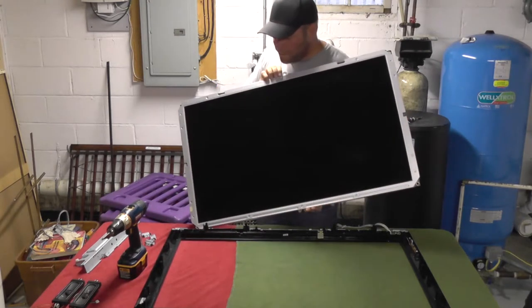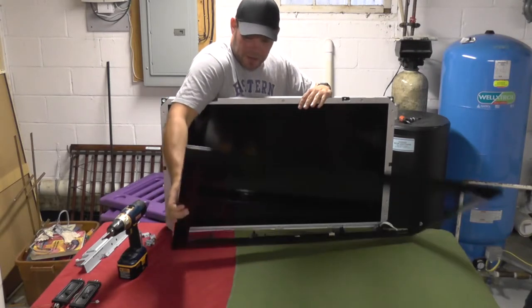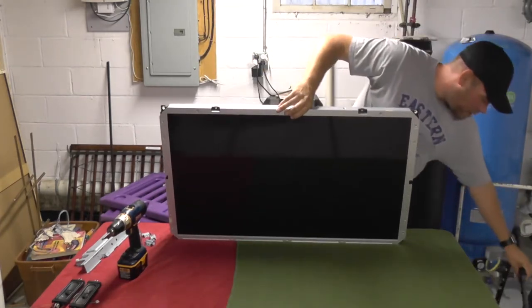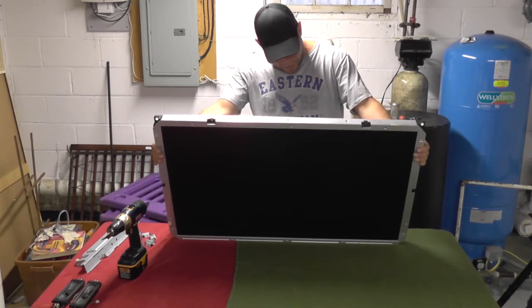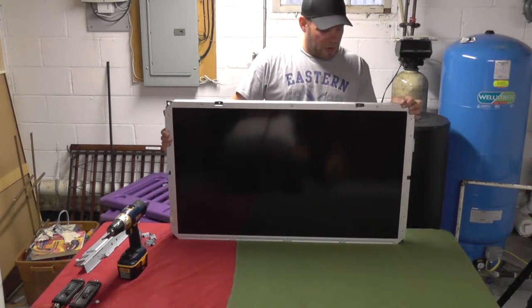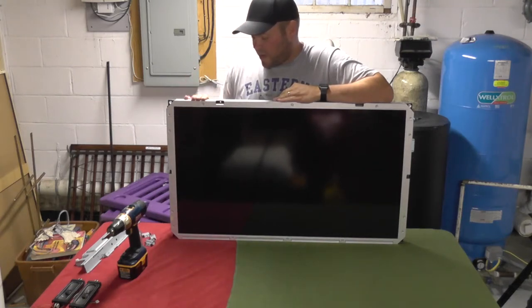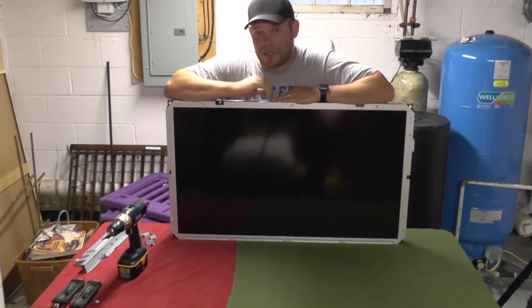Well, that's a step closer to where I need to be. I keep saying LED panel — it's the LCD panel with LED backlights on this one. That's just the front frame of the TV. That little power strip goes to the power button, so that's not what I was thinking. I guess all the other power goes to the T-Con board. What I'm actually looking for, based on images I've seen, is right around the LCD itself. I think I'm going to try to take this front plate off, because I think there are little tabs on there right underneath this thing. So let's try that next.